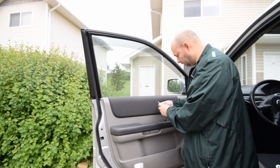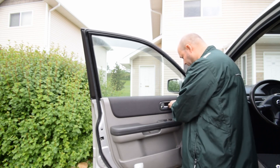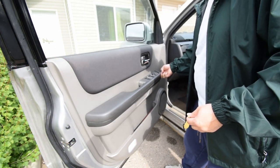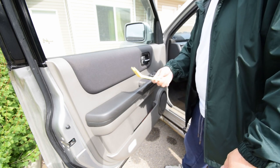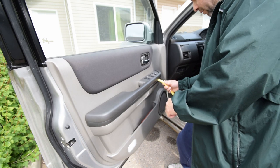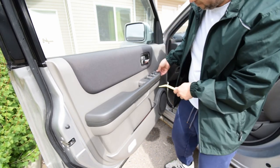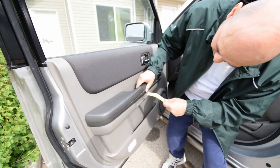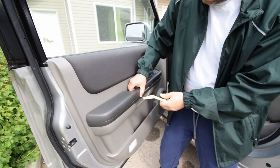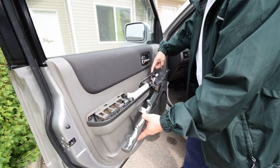We'll start at the back side of it with a small flathead screwdriver - actually it was the front side. At the front of the door there's a small notch that you'll want to insert your panel removing tool or a flathead screwdriver. Get it up here, pop it up, slide it back. You can get your removal tool in the small opening here - flip that one up and to the middle where the handle is, then pull straight up just like that. You'll get to two connectors here - we're going to remove both.